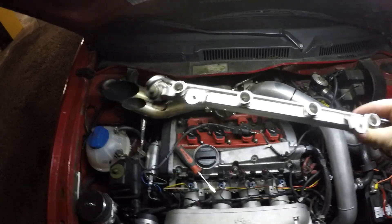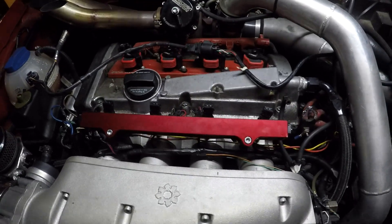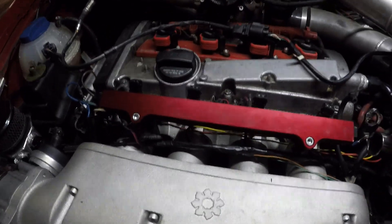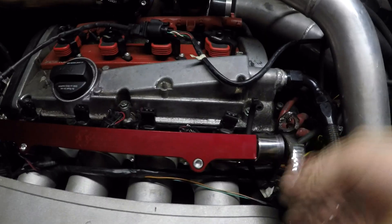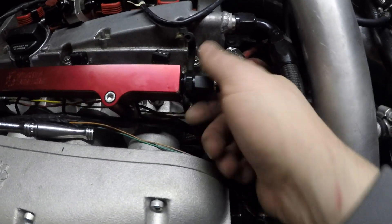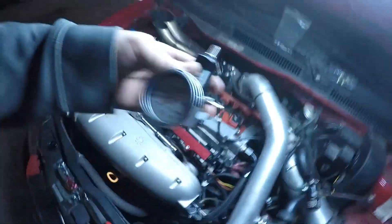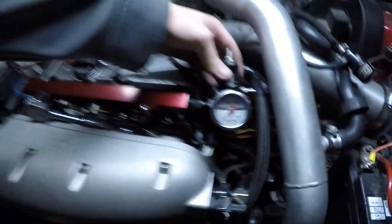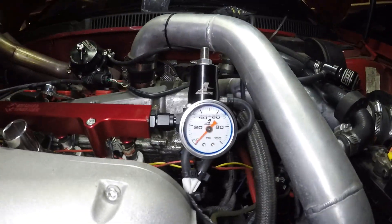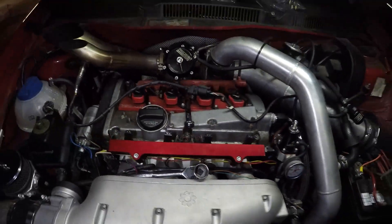Hopefully we can say goodbye to this fuel rail forever — still going to hold onto it just in case. Got the new fuel rail sat on there and bolted down a little bit. This was the fitting I was worried about because it snapped off right there, but once I put it in here it was no problem to come off. I'm going to replace it with this fitting right here — same as the one that broke, I'm just not going to tighten it like a gorilla this time. Right here we have the regulator; it's going to screw on just like that and sit just like that in the car. Real nice. That's what it looks like all buttoned up on the fuel rail — fuel pressure gauge, return line. Not too bad looking.